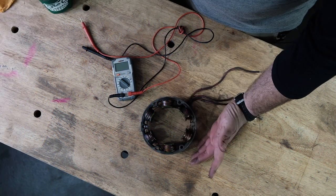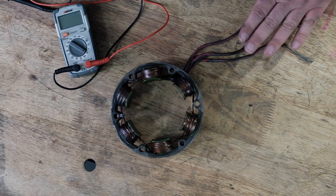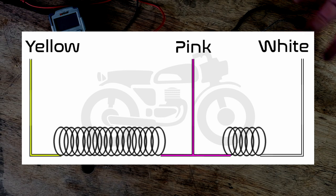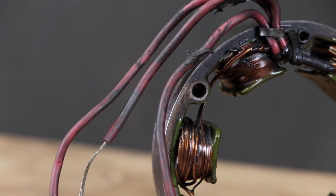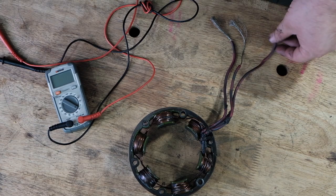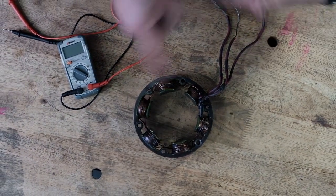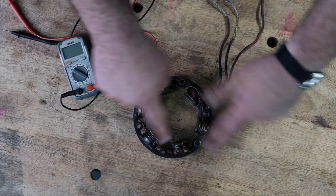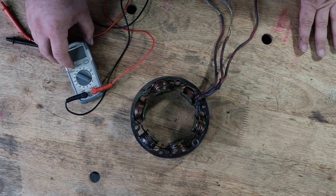Here's the stator coil out of the bike. We have three wires coming off it. Typically we have a white wire, a yellow wire, and a pink wire, as you can see in our diagram on screen — this shows how the stator system is structured electrically. However, someone has gone in and repaired this at one point and changed all three wires to the same reddish color wire. So I don't really know which one is which, but I can figure it out with a multimeter. Not only will I be able to figure that out, but I'll also check for continuity through the system to make sure there isn't any broken connection throughout the entire circuit — so we're testing two things with one test.